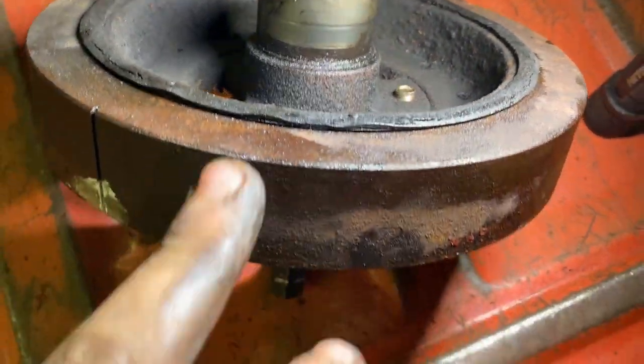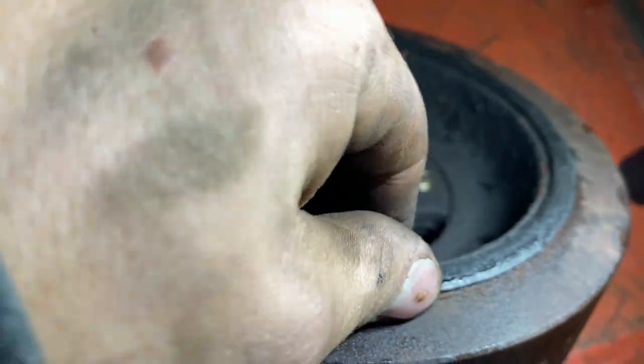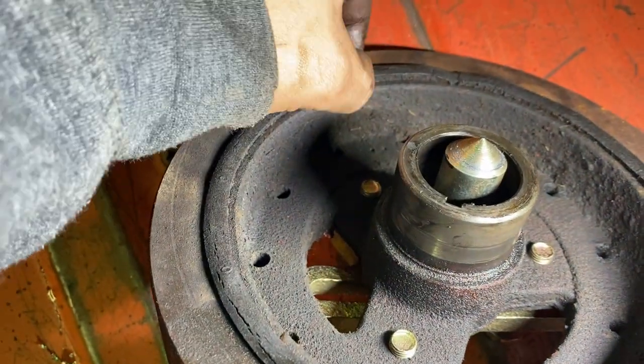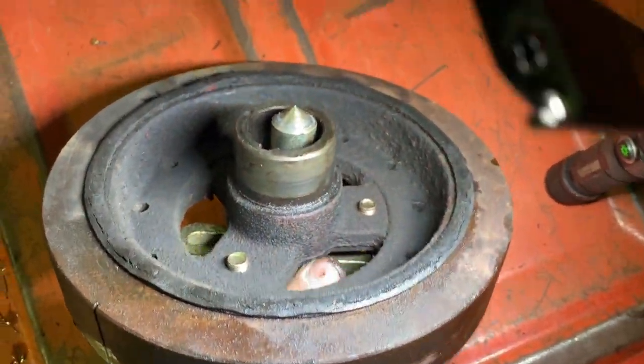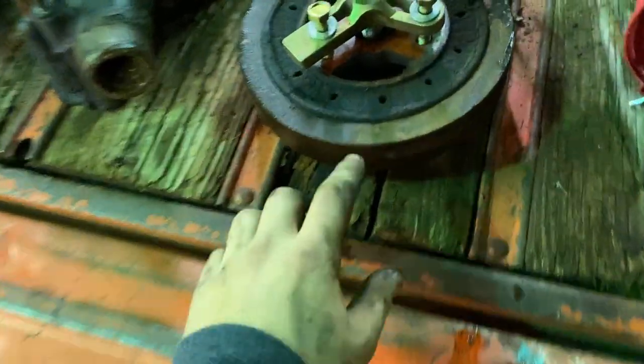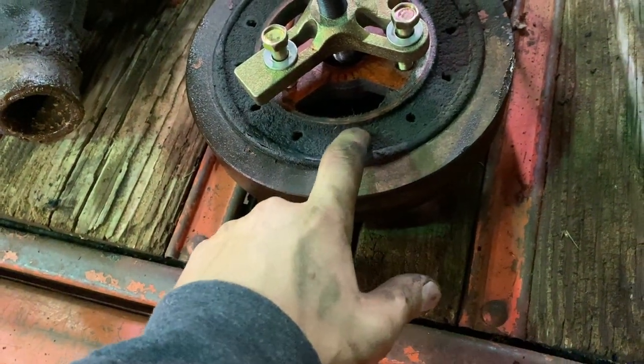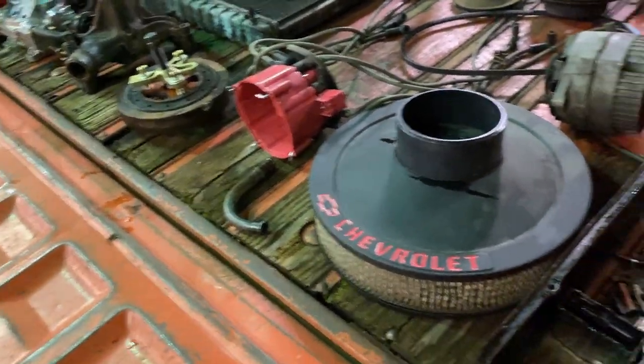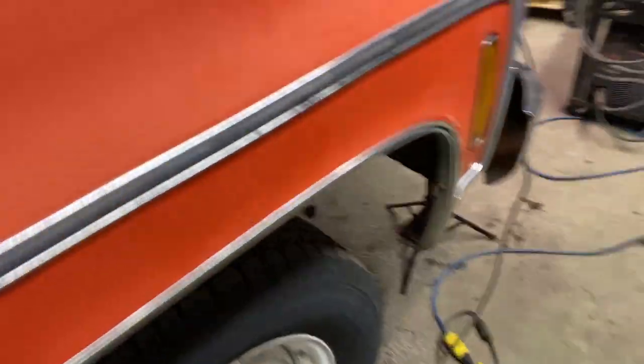If I can't find a speedy sleeve, I'll look for a new balancer, because I see the rubber here is cracked. It's actually pushing out too. When you start getting into performance, which this isn't a performance engine by all means, this metal piece can actually slip from this piece. It'll slip on the rubber. Then your timing marks are way off, and then you're really in a world of mysteries, because once those timing marks are off, you will be stumped every time you try to time the engine.